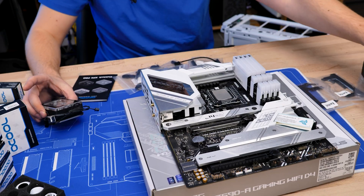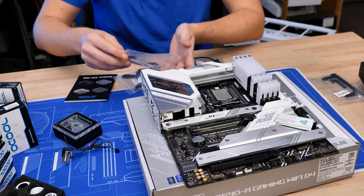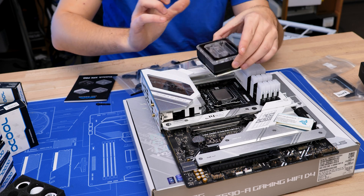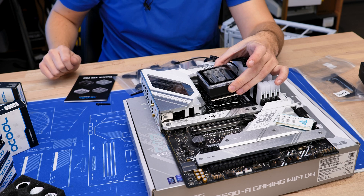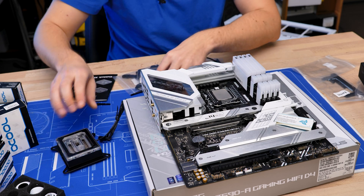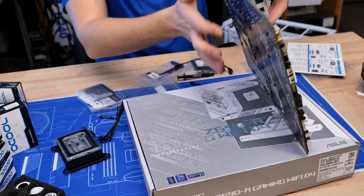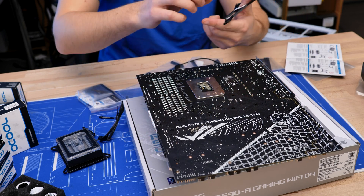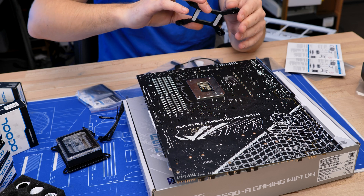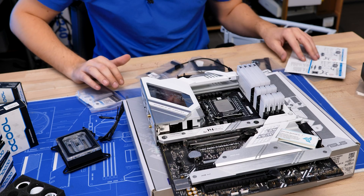Installing all this stuff shouldn't be too hard. First off, we need the Intel bracket on the water block side. I'd like to install it so the Alphacool logo is nice and visible. Oh, it's top-bottom. Nice click and they're in — easy first step. Alphacool provides us with a nice little Intel backplate. Just peel these off, push the standoffs to the outermost position. Socket ready.